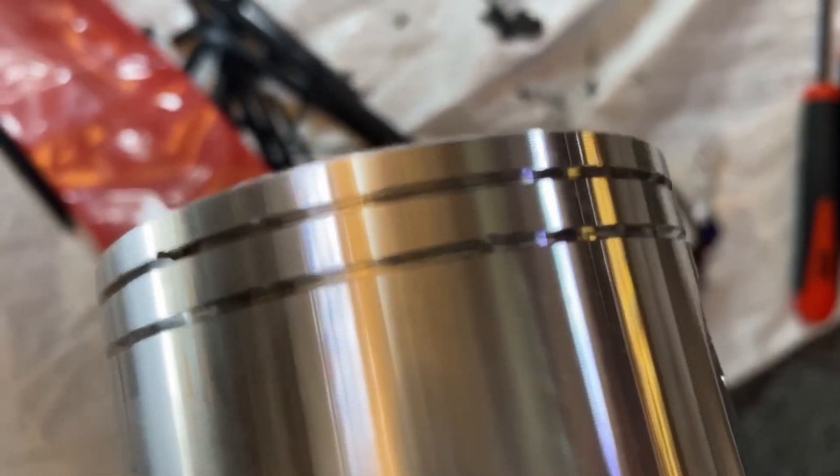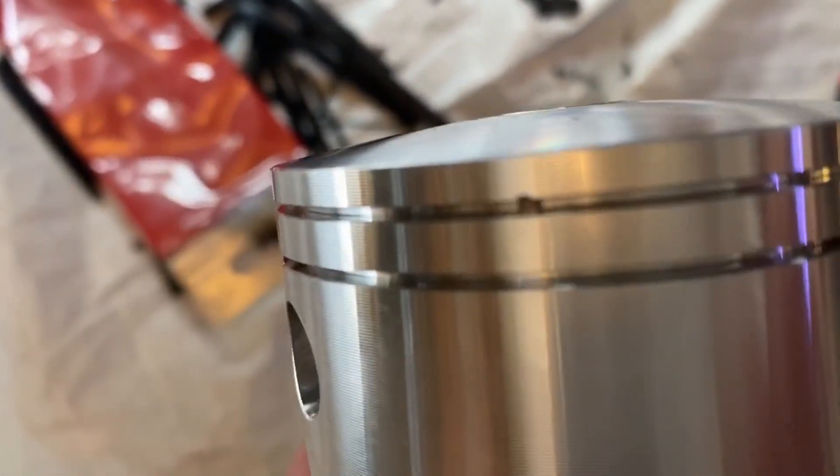Now I'm gonna put the rings on the new piston and put in that new bearing. For the new rings, you can see those two little centering pins — I'll show you when the rings are on. The piston has an arrow pointing to the exhaust side, so really you can't mess up the assembly unless you break something.